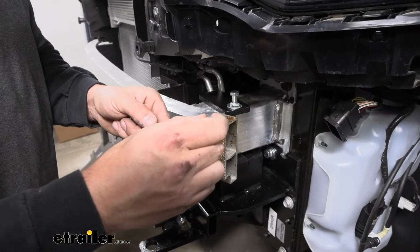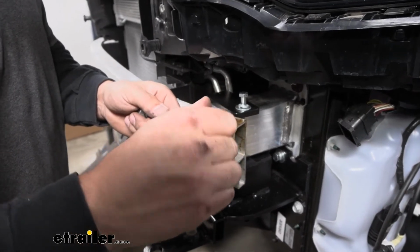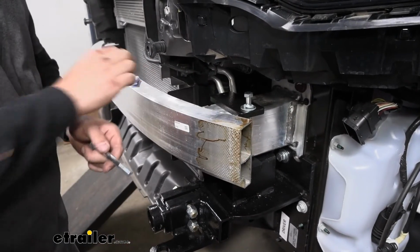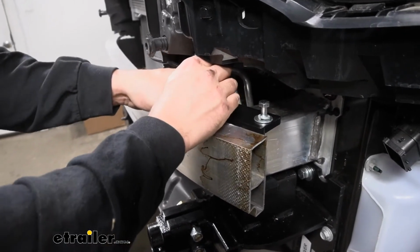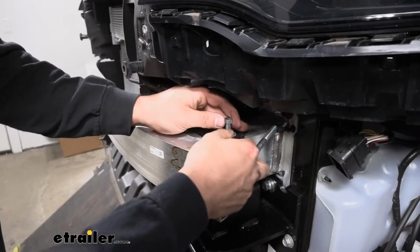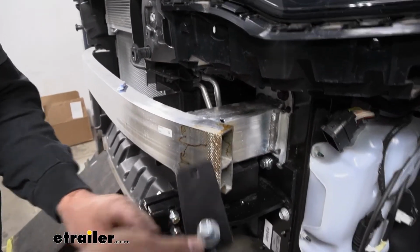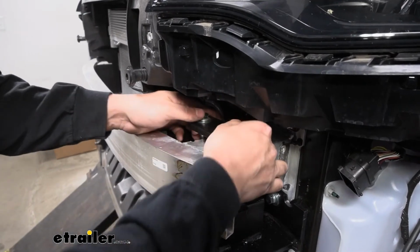And these are actually the 2 bolts we're going to torque first. If you remember, we left all the other ones loose earlier because we need to draw the base plate up towards the bottom of the bumper beam before we start torquing those. So these will actually get torqued first. And you know what? I think I'm going to put both of those into that plate first. I should just be able to stick it through like this and rotate it down. Yeah, there we go.